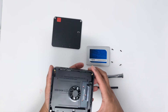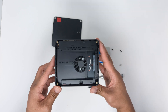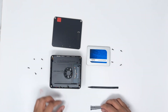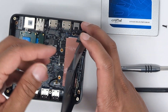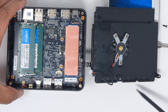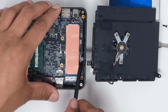The first thing we see is the tray with the fan cooler where we can easily mount a SATA drive. To get deeper into the box, we will first need to remove the three screws holding the tray in. The drive tray comes right out, but be careful as there are two cables attached underneath. I'll go ahead and unplug the fan cable. Underneath the tray you will find the NVMe SSD covered by a thermal pad, and our two 8GB DDR4 SODIMM modules. I will now unplug the remaining SATA cable to prevent any damage.